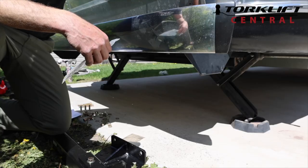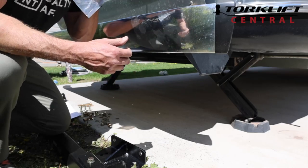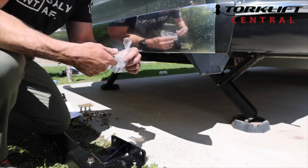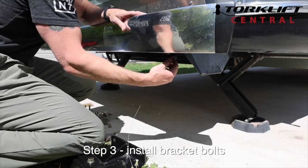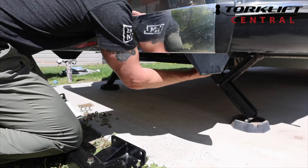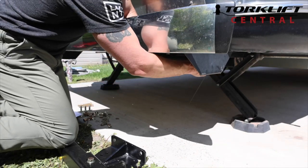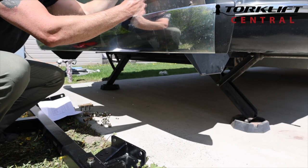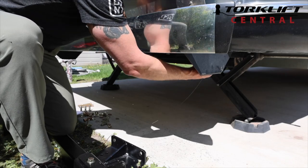Because this frame rail right here on the inside of this bumper is a rectangle or square, they give you this line that you can fish your nuts and bolts in there with. So what you do is you run this up through the hole and fish it out to the end. Between this part of the bumper and the frame rail, there's a gap on the side. Then you take your stack of bolts, screw it down onto the spring, and pull this back through that hole. Very handy — this is a pretty ingenious tool.